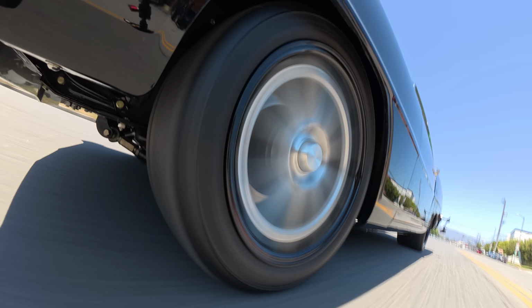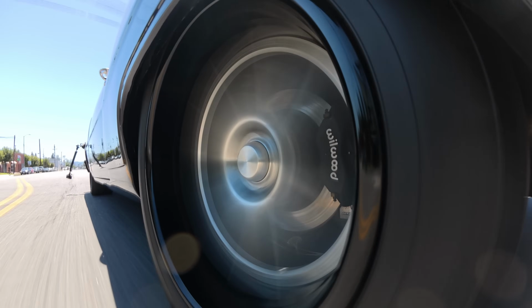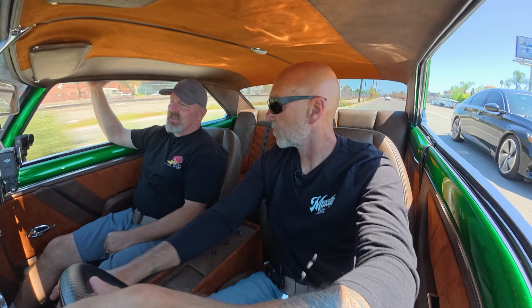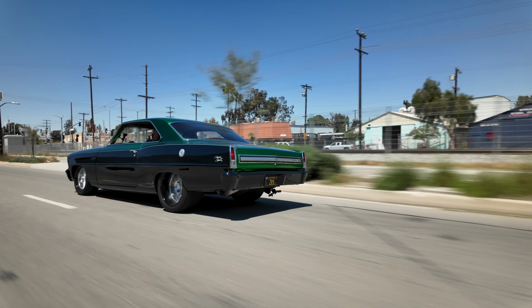All right. For suspension, she's got a full Church Brothers Racing setup, front and rear, a triangulated four-link. It's Detroit Speed mini tubs, all tied in with subframe connectors. For the engine and powertrain, it's got a 2011 LS9 that's been cranked up to about 900 horse, about 750 at the wheels on E85. It's the 6-speed Tremec transmission with a dual disc clutch.